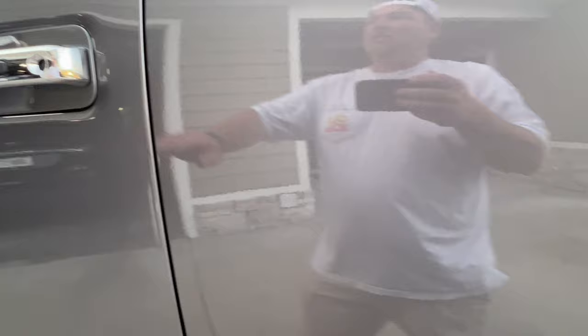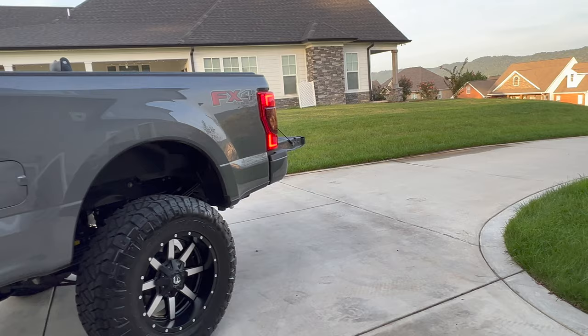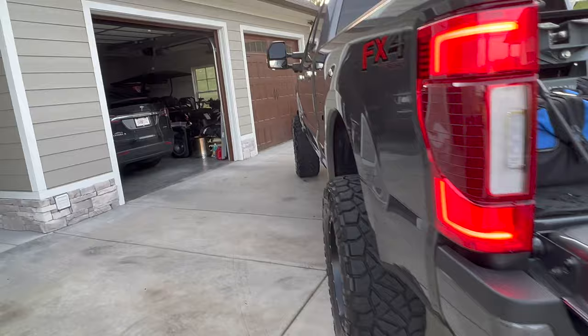Everything's the same on the switches. I had the compressors put on auxiliary 5 and the horn put on auxiliary 6. The horn itself, if you just open it up, will empty the tank in about 8 or 9 seconds. It takes probably a good 5 to 6 minutes to fill up the tank with the dual compressor.